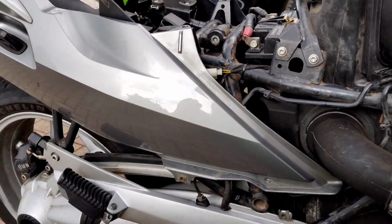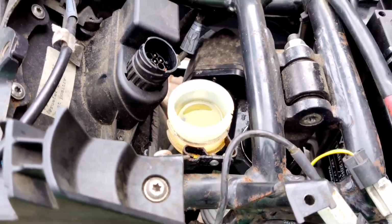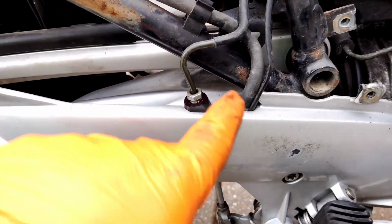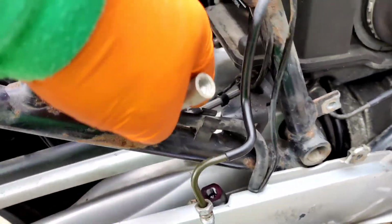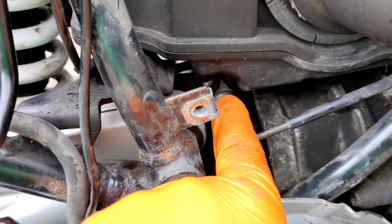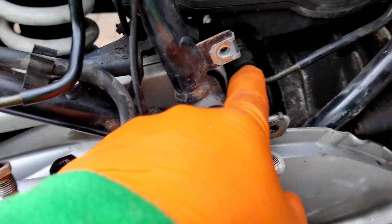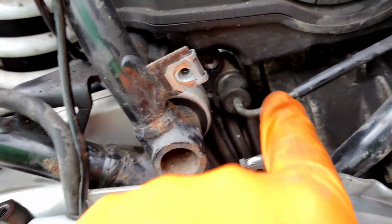So I'll take the back Tupperware off. I'm going to remove all the fluid from the rear reservoir, and then I can take the hose off of there. Okay, so pulled that pipe out from there. Now the brake line goes into the back there. There's a banjo in there, and then that pipe and the banjo connects onto this solid pipe going up to the combobulator. So this bit I've taken a bolt out of. There's a bolt out of there, so that's like a junction piece.